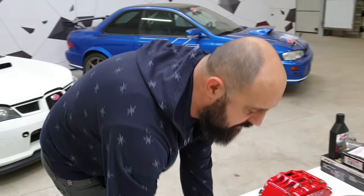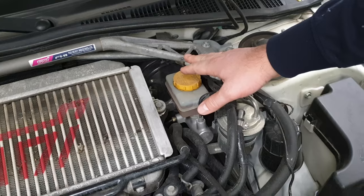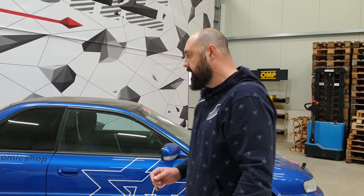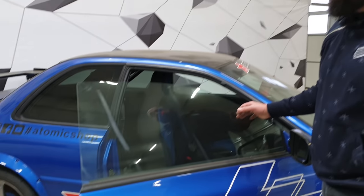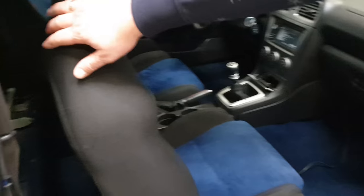The same situation applies to the front end — but this car is already tuned from the factory, so when you open the hood you will see the brace here. We should also reinforce the firewall so it will not crack. If you don't have it you should have it before you go on the track. Basically Subaru did a lot of work here, but you still need to add something. When you take a look at this car, from the outside it's basically just an Impreza GC8, but inside it's converted to STI 2007 components. The 2007 STI has a grey brace — it's a factory detail which also prevents body flex. This car particularly also has a half roll cage.